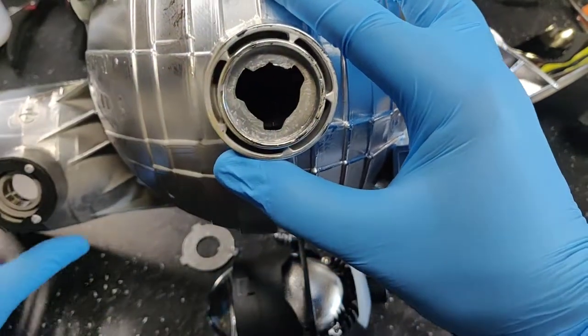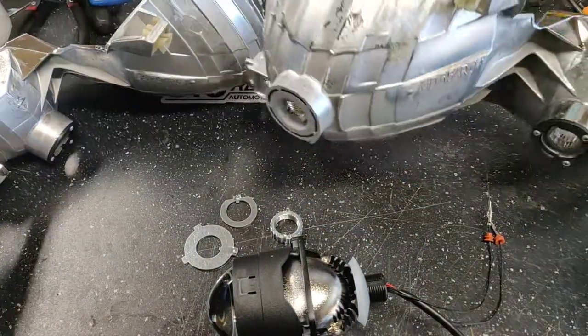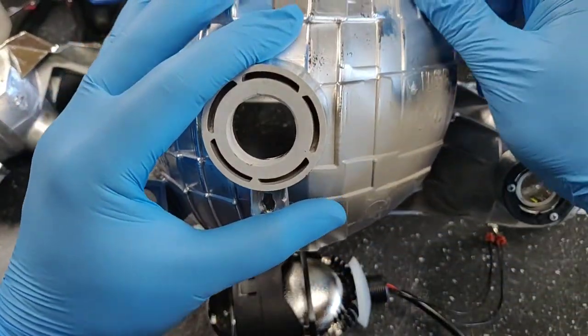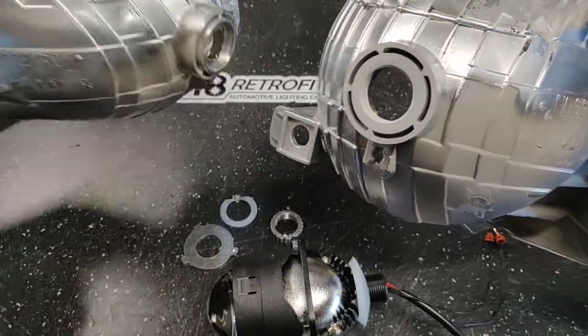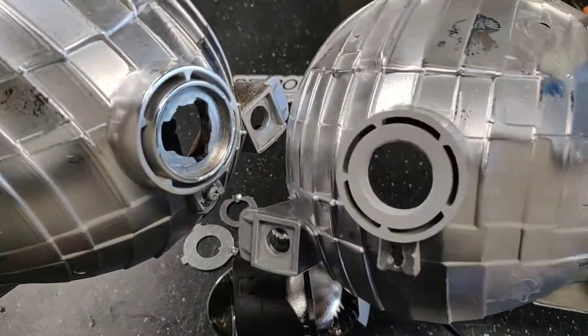Most H11s are just the same. I've already prepared this one off camera — I'll show you the other side. As you can see, we've bored out that hole, basically removed the notches, and then we've taken our belt sander and just flattened this out. You can see the two side by side — there was that notch and it's now flattened. So this is now ready to go.